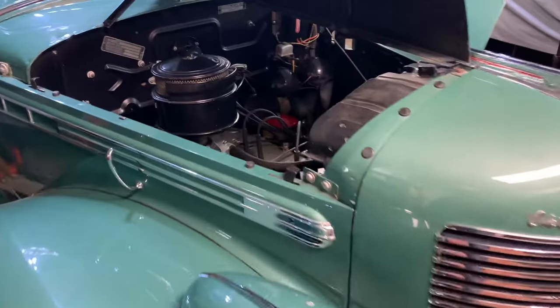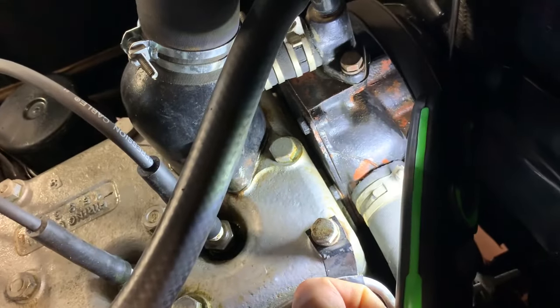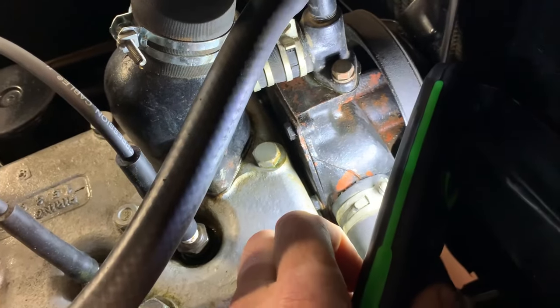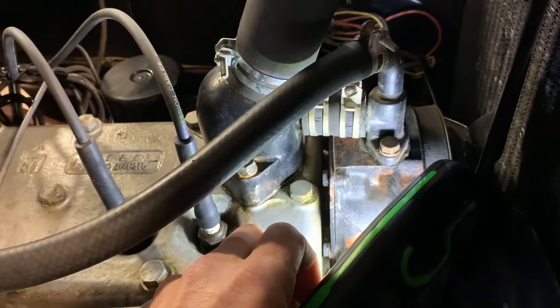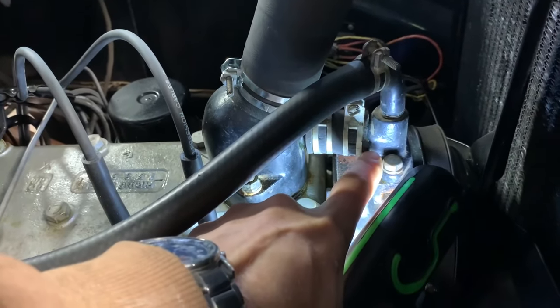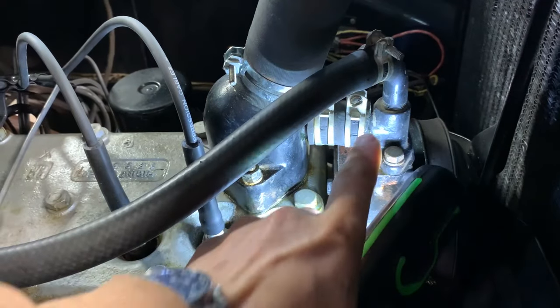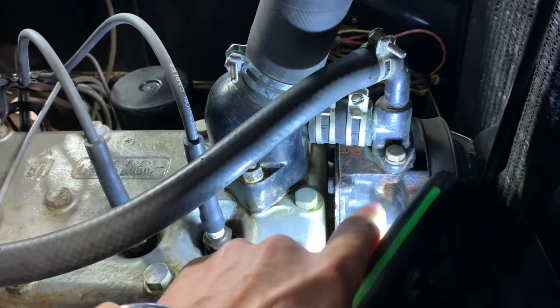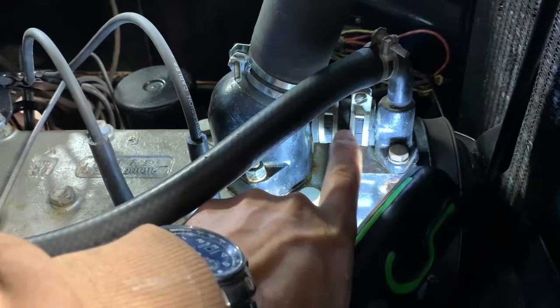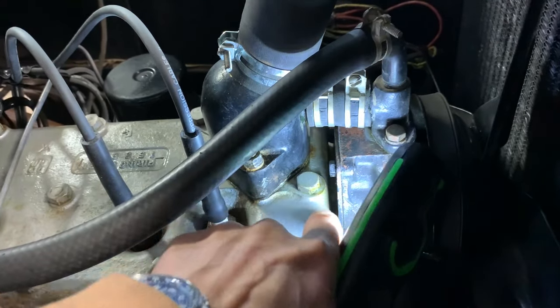Okay, let's compare my 38 Chrysler engine here. If you look down there in the front of the cylinder head, there's no little hump there. And you see there's a little jumper hose that goes across from the water pump into the thermostat housing. My other engine does not utilize this style water pump. It's just a little different. The bypass, instead of having this hose up top here, you've got that little hump down on the block where the water pump bolts up.